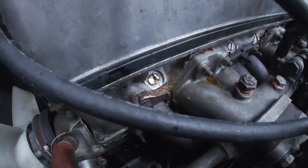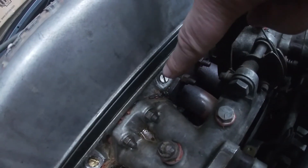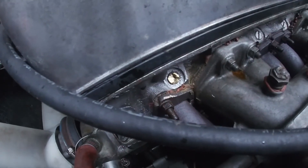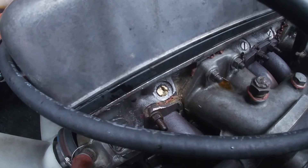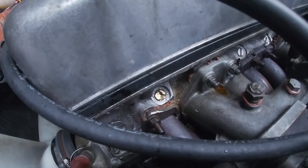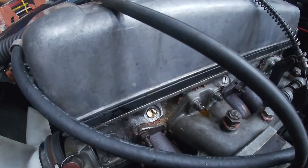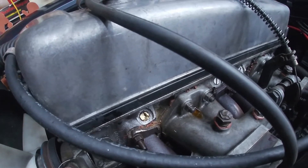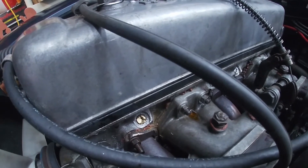The reason I need to remove the head is I need to fix the plug that is broken down here. You can see this guy right here should not look like that — it should look like that. There's a brass plug in there that I could not get out due to it basically breaking off and stripping. The only way to get that out — I have tried heating it up, using a punch to try to twist it out — I can't really drill any further in to get an extractor in there, because the plug itself is hollow on the other side.